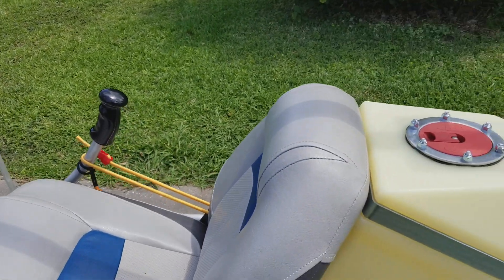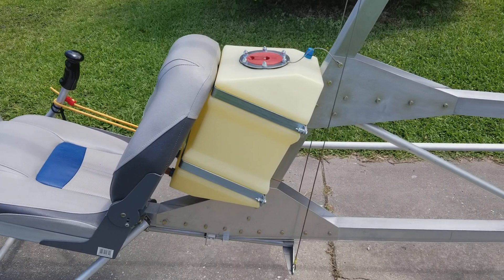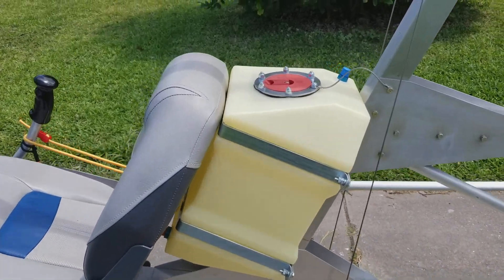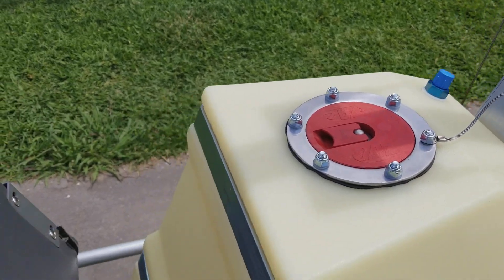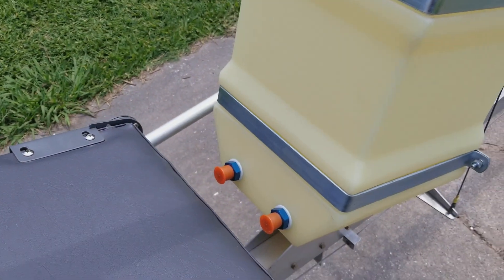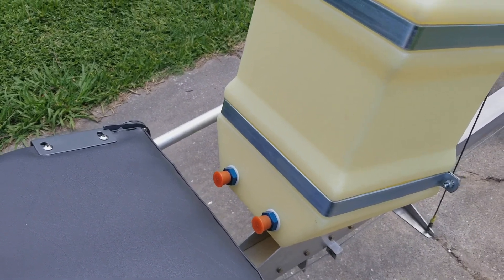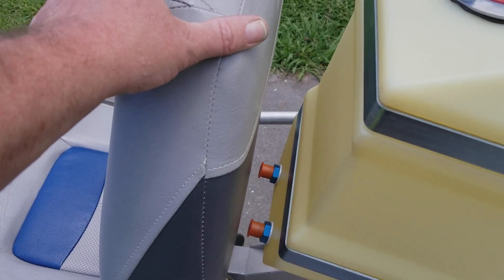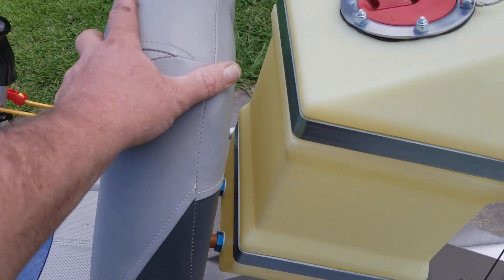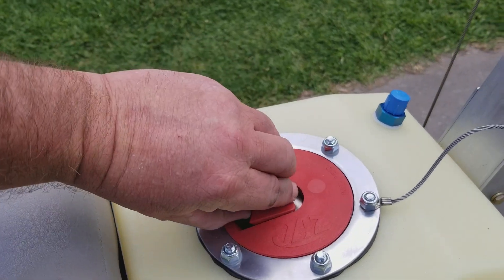Also new is a fuel tank which we purchased from Summit Racing. It's a five-gallon tank, grounded to the frame of the airplane. There are two outlets down here — I think I'm going to have to get some 90-degree elbows to come up under the seat, since they're currently real close to the seat and can't come straight out. And we have a nice locking gas cap.